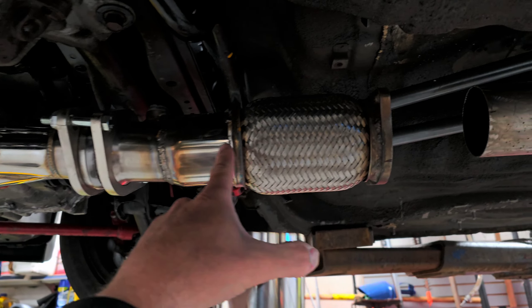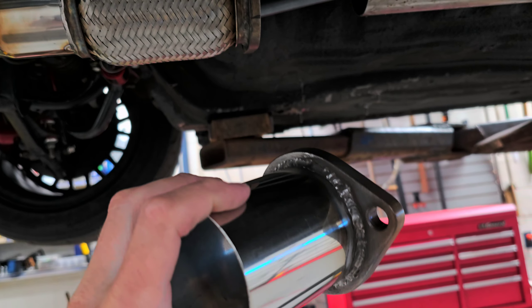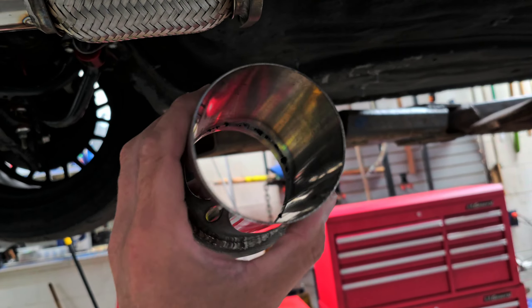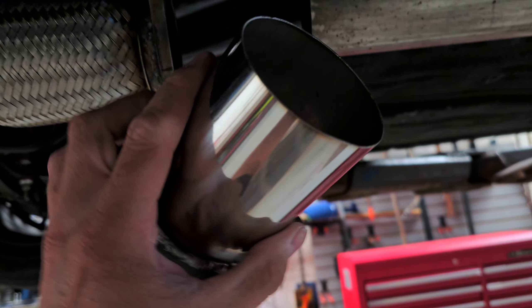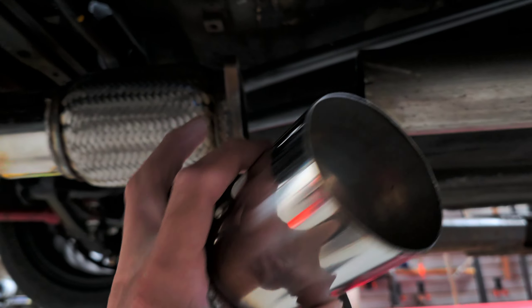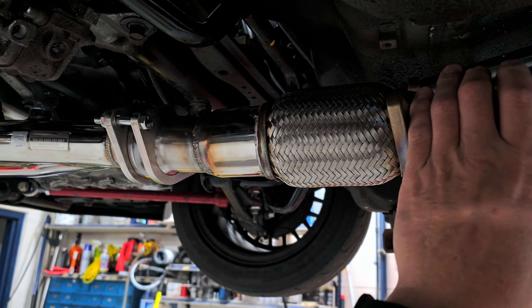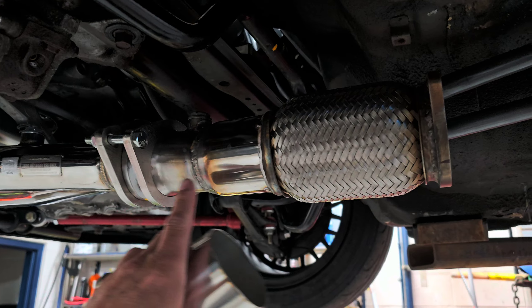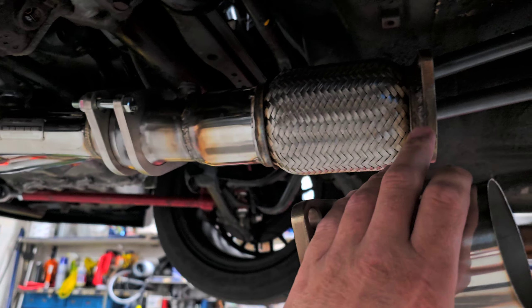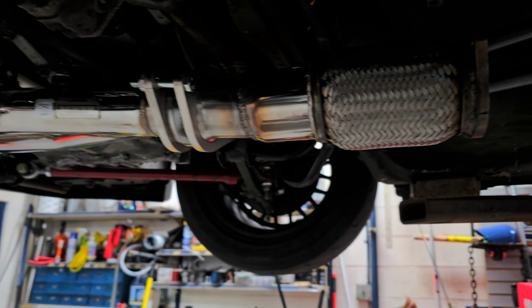The piece I just showed you is here — I've only tacked it, not fully welded yet. Got this next piece made quick; got it all TIG'd up. Basically this piece goes in here like that, and we weld it in. This is our test pipe and it'll be able to be unbolted. If I ever turbo it again, I'm going to redo the downpipe with a removable section so it'll bolt up — basically a nice universal setup in case we decide to change anything.